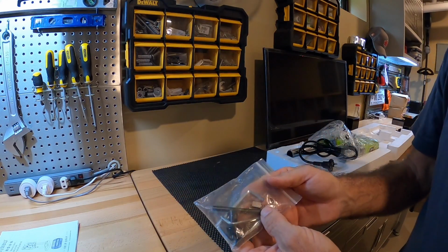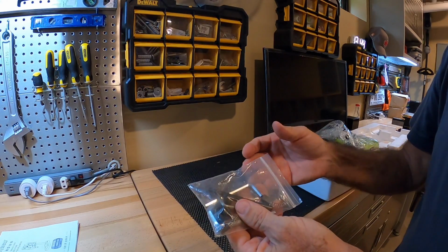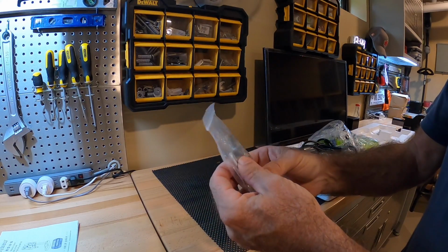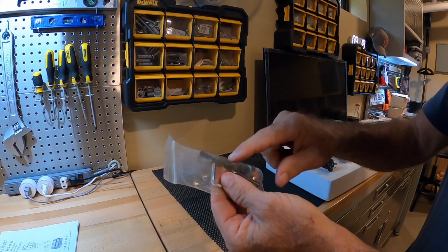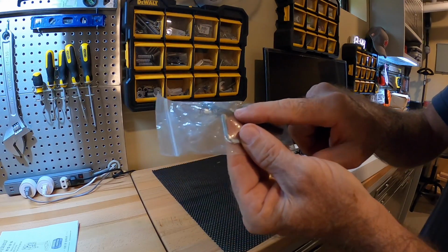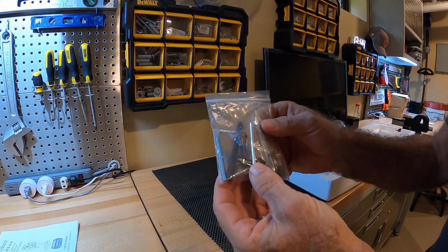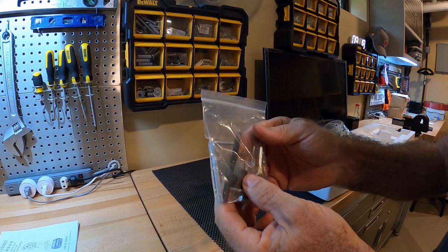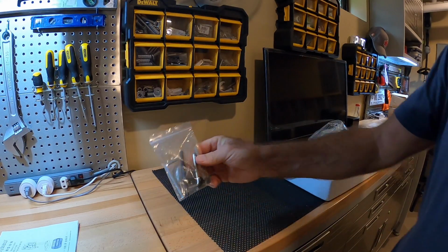You're going to find when you buy items inside the Philippines, we're in the U.S., we're going to pretty much a brushless type of a tool system, but over there the tools use brushes because these things wear out. The motor will spin on the inside. This is what applies the electricity to the motor, but it spins on this little carbon brush inside here, and eventually they wear out. So what happens, you'll find a lot of tools come over here with spare brushes inside, and you can pick them up in any of your little hardware stores on the side of the road. You can usually get these right here.